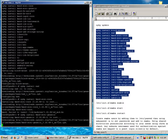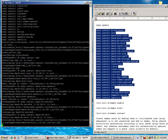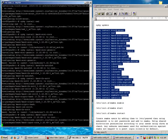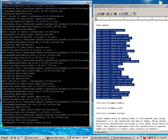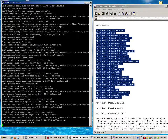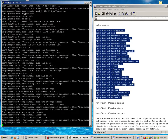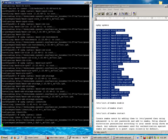While it's installing, I'll talk to you about what all you can connect at this USB port. You could hook a printer up to it and be a print server for your printer. Also, you could hook up a USB CD-ROM or external hard drive, or a USB 3G card from Verizon or Sprint, and get internet like that. But they need packages so you can configure them so they'll work. You just can't grab your router that's got a USB port, cram something in it, and expect it to work.